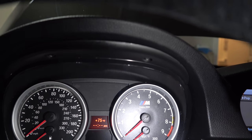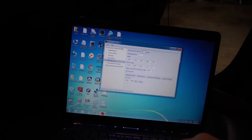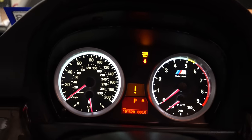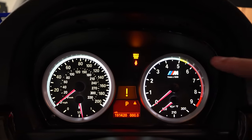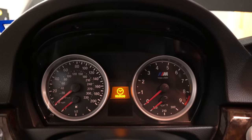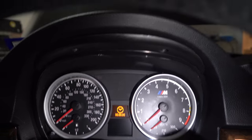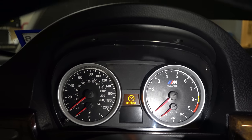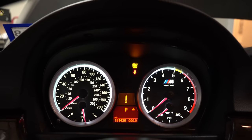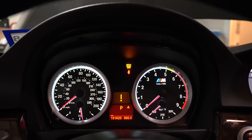So it's reading a bit high right now - I want that to drop down a little bit. So let me try the offset start position offset, let's try 32 steps. Okay, so now by doing that it pushed it over past 5, and I'm going to turn the key off now. And now it drops down - that looks good. You don't see any of the red when the key is in the off position. So I like that - I'm happy with that 5,000. And if it slowly drops down to the bottom position then that kind of indicates when it's fully warm. I'm good with that.